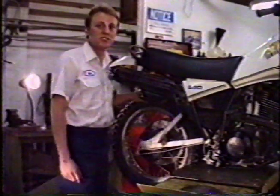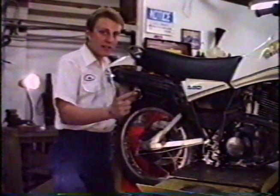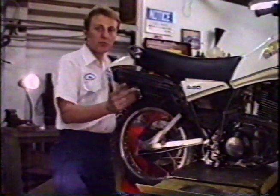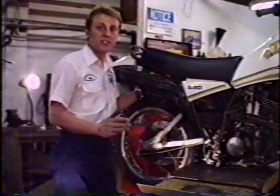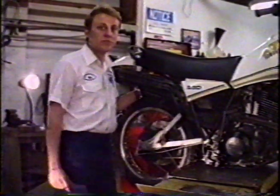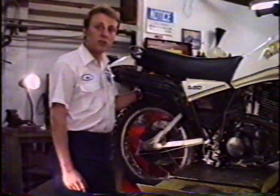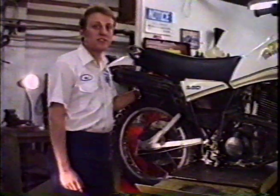Set your suspension stiff. That'll smooth out your wheelies. Go stiffer on the preload, get a heavier spring if you can, set your compression and rebound damping as stiff as you can. On tires, you want them soft. Go with a thin ply tire. I recommend a Bridgestone M22. They work well for me. They worked great for the guys on the stunt team.